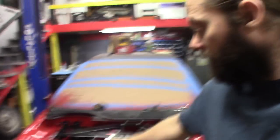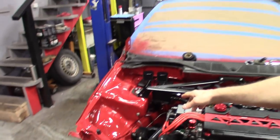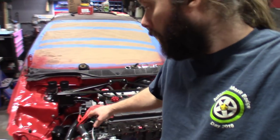I gotta lengthen the wire, so I'm gonna have to cut them and section wires in. You can't find all the pins for it, so there's gonna be some wires that we cut in the harness. You'll see me do mostly the main one that routes back in — they come out underneath the battery tray. The main harness goes back in from the fuse box. That big fat plug I'm gonna leave in the car the whole time, so the only wires coming out of here are the ones plugging into the engine.